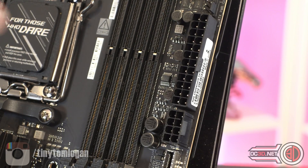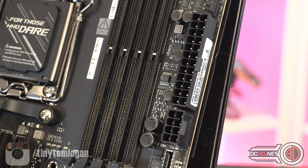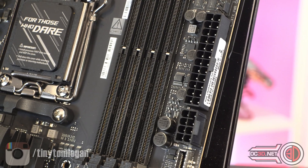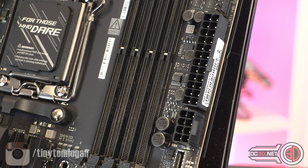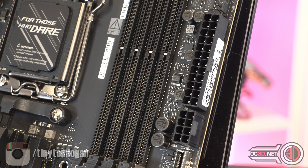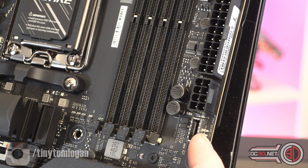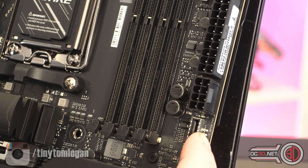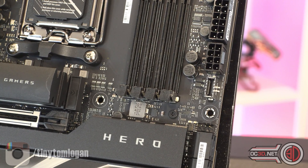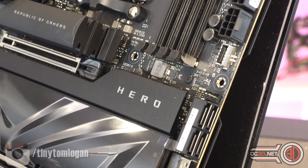Moving down, the 24-pin connector has solid pins, and there's an additional 8-pin down here to feed extra juice into the PCI Express if needed — that's ATX 3.1 spec. We need to keep an eye on this as we start getting power-hungry graphics cards; if things are right about the 5000 series, we might actually need it. There's a USB 20 gigabits per second connector with a 60-watt charge option — one of two on the motherboard. Moving further down, there's another fan header and then four SATA headers.